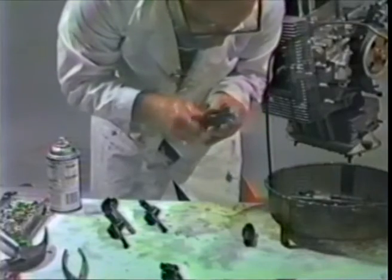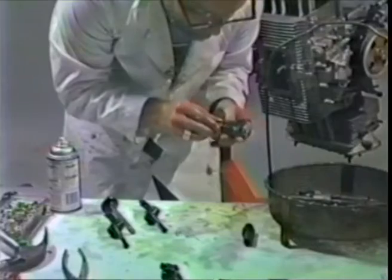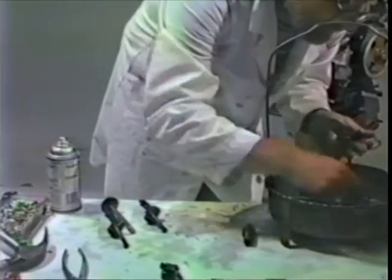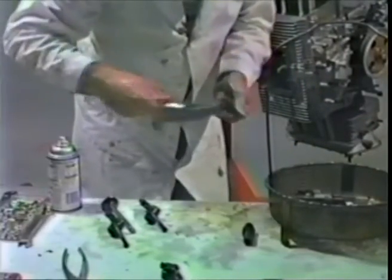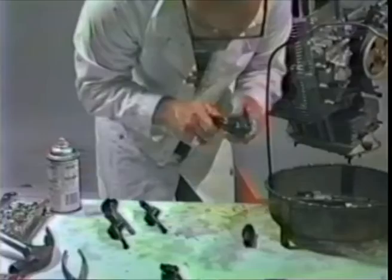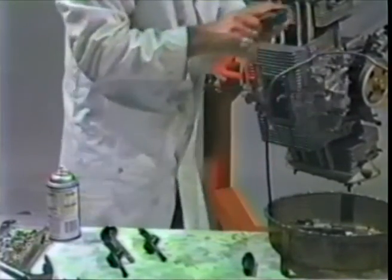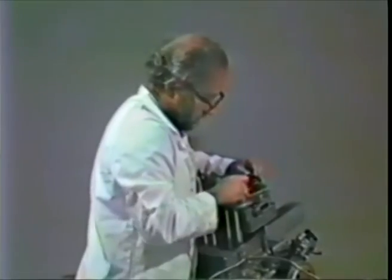Make sure that the area that's worn is up on top facing you, like so. Put the other washer and the cap on. You can tap those too to get them on. Do a triple check on the crud, or any score marks here. Make sure there's no crud. Make sure the rocker rotates fairly freely. And the exhaust rockers, the short ones, go one to a side.